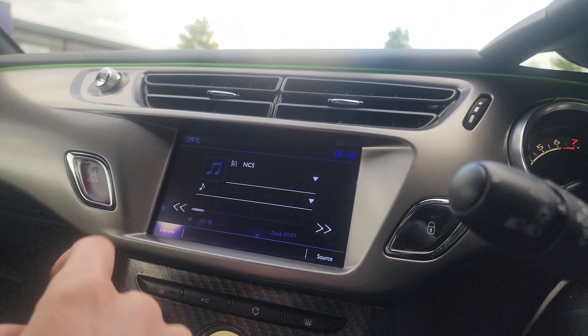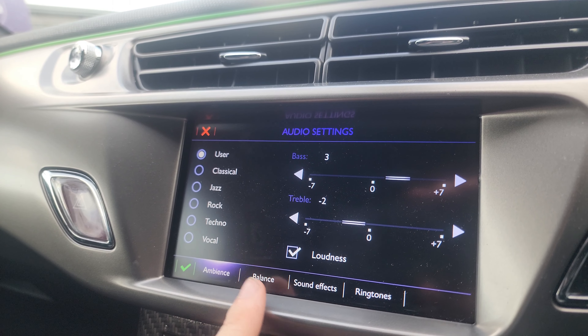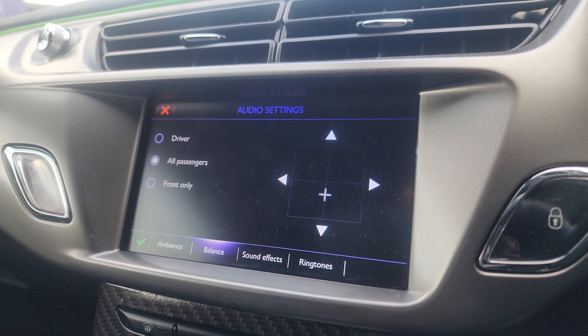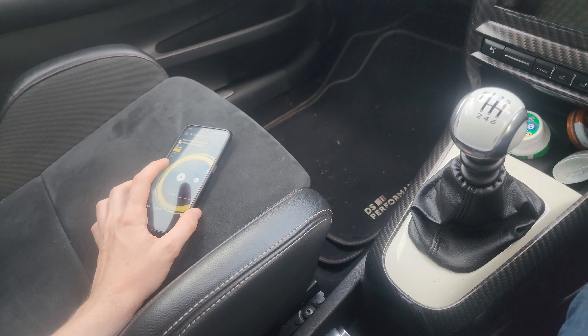It's a very full-sounding system actually. The front speakers were fairly cheap - about 40 pounds for the two front speakers and two tweeters. The rear ones are 80 pounds. They're not super expensive, no mid-range stuff. On the audio settings: it's just on User, loudness is on, bass is up to three, channels minus two. Because the rear speakers are a little more expensive than the fronts, I've got more power going to the rear ones so there's less distortion, and it seems to work really well.